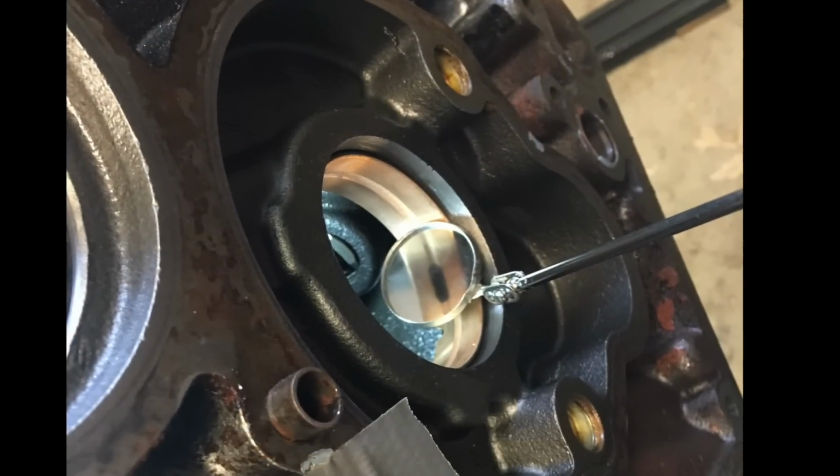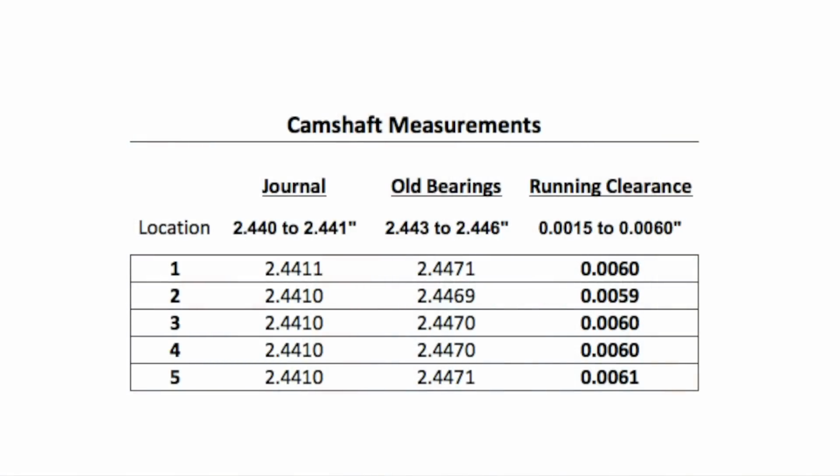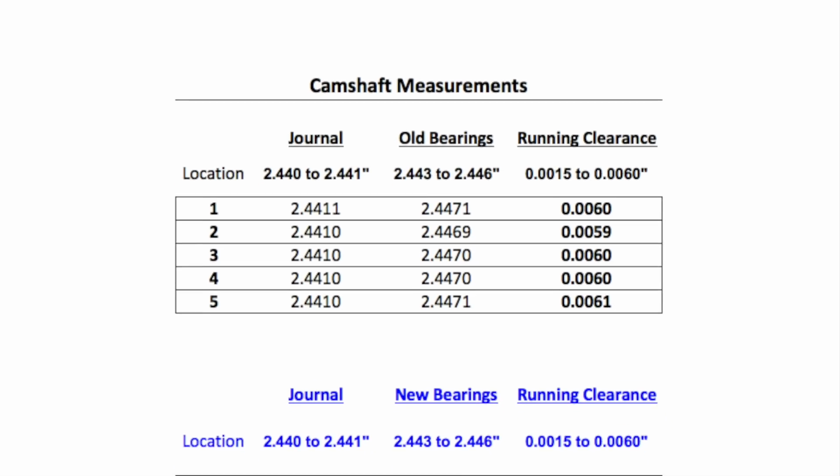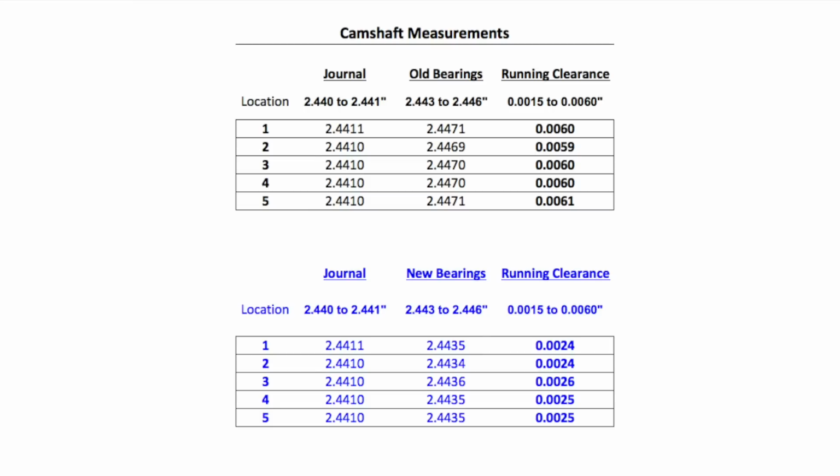With each bearing install, you need to check the oil port for alignment, too far forward, too far back, and indexing. This can be done with a simple inspection mirror or a $35 borescope. And that Amazon borescope for a smartphone is a handy tool. With the existing conditions, this motor was at the broadest running clearance. But with the new Navistar bearings installed, oil pressure will slightly increase because of less internal leakage.